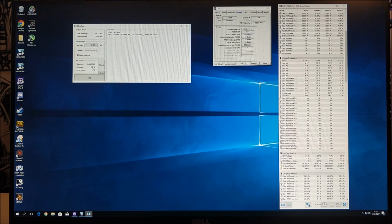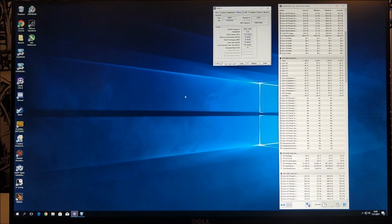And yeah, I'll try to contact Mustanamio if he has a plan to release this software, like in a web shop or something, I don't know. But yeah, anyways, that's about the memory. I've been running this mem test for these memory settings over and over and over again for thousands and thousands of % coverage over the memory, and it hasn't found any errors yet. So my kit is stable at 4133 megahertz, latency 19. So yeah, well done Asrock for great memory support.